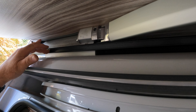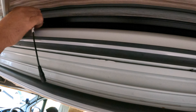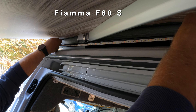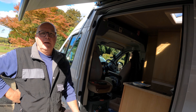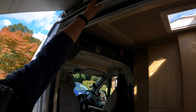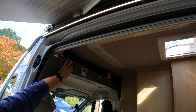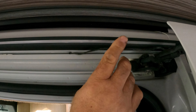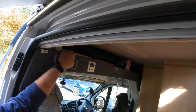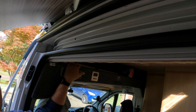Mike has pointed out we need to make sure you've actually got this strip. If you want to do it, make sure you've got sufficient awning that will take it - there's a little lip there. This is the F80s awning, it came out about five or six years ago. One little benefit Mike has got is he's had a light put along the top of his door, a door entry light which lights up. So far we've found the cable that feeds that strip buried in the top of the channel, dug it out, and we propose to cut that wire and introduce the LED strip cabling into it so it can all be turned on by the one switch.